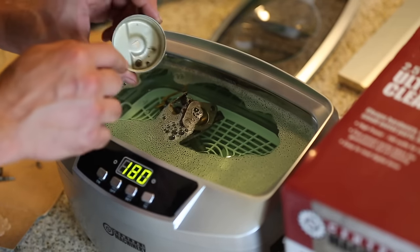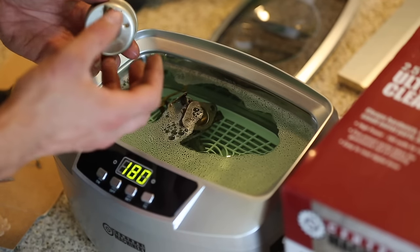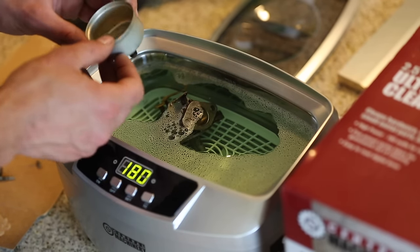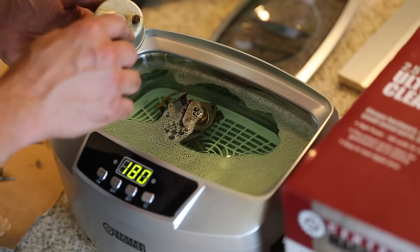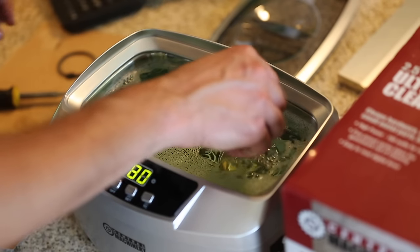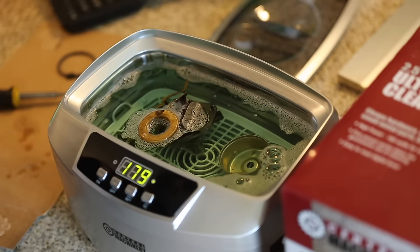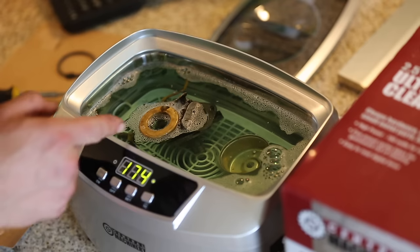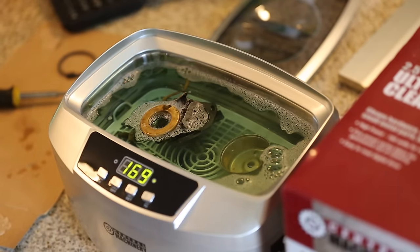I did take the epoxy off of the repair I made on this bowl. It didn't set properly when it was exposed to gasoline. I don't know if epoxy is actually supposed to be resistant to gasoline once it's fully cured. So maybe once this is clean, I'll just try a TIG welding repair on this. I assume this is made of aluminum. Wow. You can already see just gunk and stuff coming off of all the things in there. Here, let me get a close-up of that.